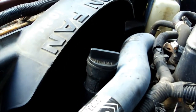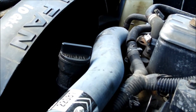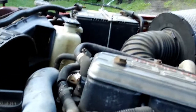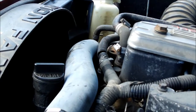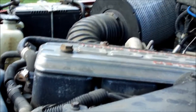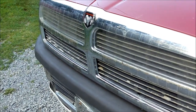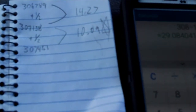Turns out you basically almost don't need a fan. I got caught in stop-and-go traffic for five miles on the interstate when it was about 80 degrees out, and she started getting a little warm — up to 200, 205 degrees. I put the heater on and it actually brought it back down. We held steady with no fan in gridlock traffic with just the heater running. Granted, I was just idling and not pulling anything, and the entire upper half of the grill was completely blocked. Under normal driving, there's no difference in temperature.